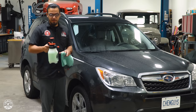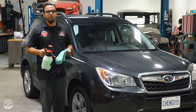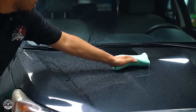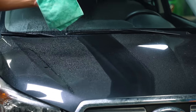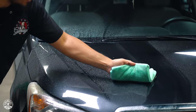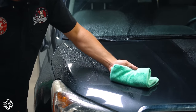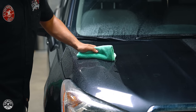This is a great way to do that because now you have your favorite cleaning product right here in one solution — you don't have to grab multiple bottles, just simply spray it and wipe it off with a clean microfiber towel. Just like we do with any waterless wash, we start at one point working in linear motions and we roll the towel so that we're not dragging the dirt and causing scratches or swirls. You can come back and buff it off with a clean towel or the other side, which is why we fold it in fours.